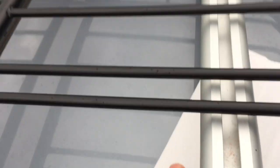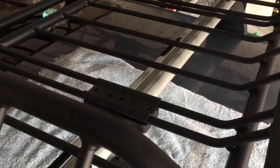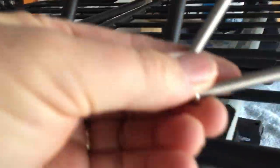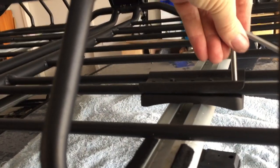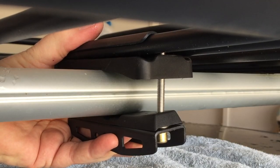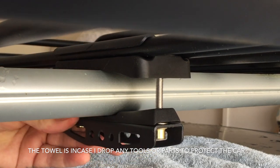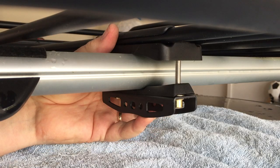The double bars here on the roof — you have a single bar here and then the double bars, which are the ones we're mounting onto. Number one on the double bars, that sits down on top. So then all that's left is to bolt the rack actually up onto the roof. You can see here the top half — this just clips together and sits in place, and then this little rocker comes up underneath. We get our two stainless steel screws and drop them through. Then we get our allen key, loop this into place so it's touching, and just do a couple of turns on each side — you want this to come up square. That's actually in place. You've got to line up the rack before you get to this point, exactly where you want it.